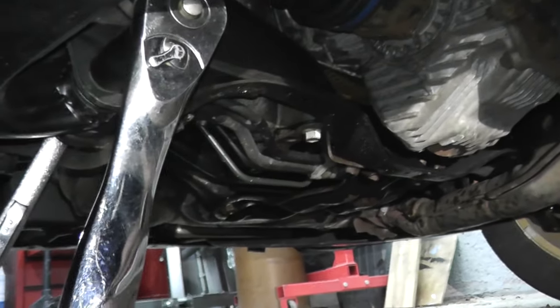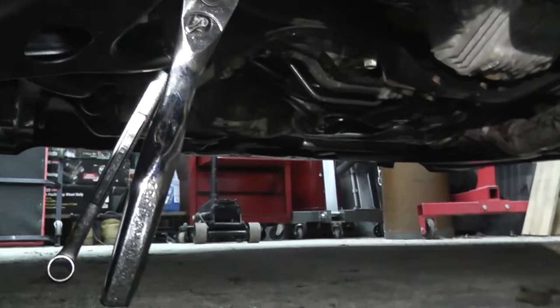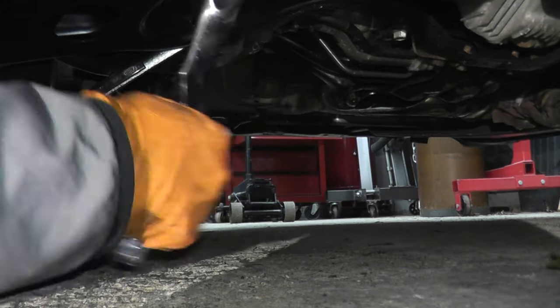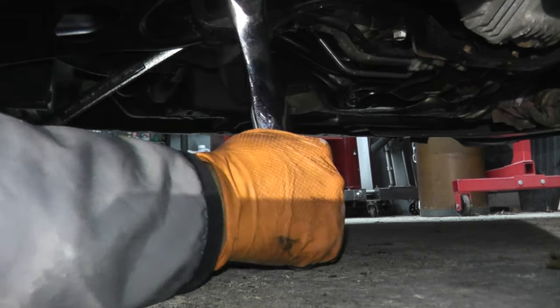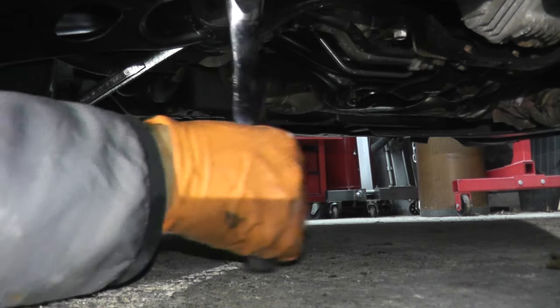Just to show you how I'm doing this: half-inch drive ratchet, 17mm socket, and on the other end a wrench holding that fastener in place in case it rotates. Without a lift I can't torque it properly, so I'm making it as tight as I can — 70 foot-pounds is pretty tight; for comparison, lug nuts on wheels are typically 75 to 80. Next up for this Subaru: valve cover gaskets. This car is falling apart, but that's next week. Thank you for watching — we'll see you then.